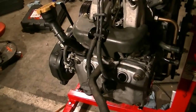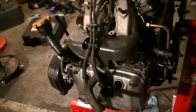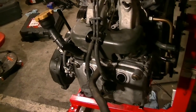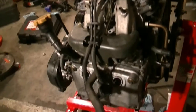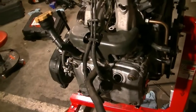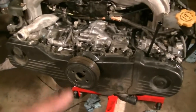The way I'm going to get this ready for its first start is to put oil in it, take out all the spark plugs, and disable the fuel system and ignition system, then crank the engine over for about 15 to 20 seconds to build up oil pressure. Then I'll put the spark plugs back in and start the car. Hopefully this won't be an epic fail — it won't start knocking or anything — but I'm pretty confident it'll be fine.